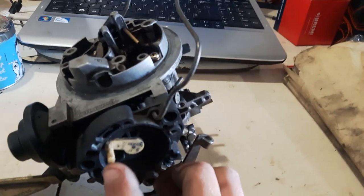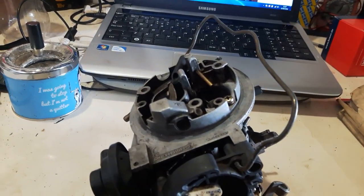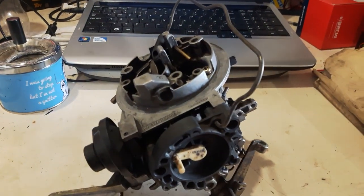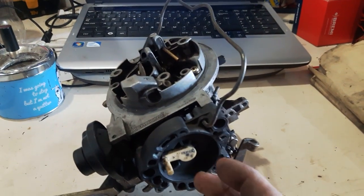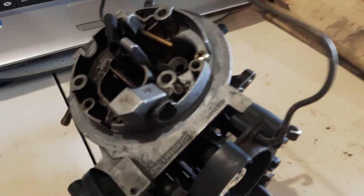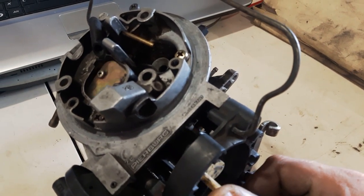The first issue he presented to me was that the choke mechanism seems awfully loose fitting. That's normal. They're a real loose fit, because it's all actuated by the spring — I guess they don't want there to be any resistance mechanically anywhere else. So they've just made them a super loose fit so that the spring is entirely in control of that movement.